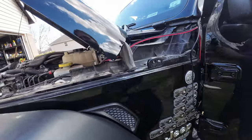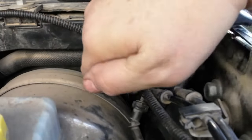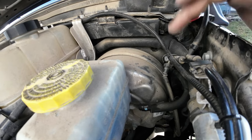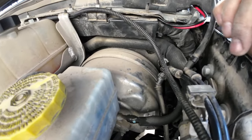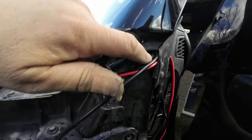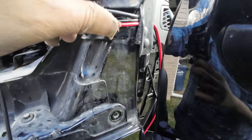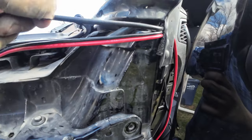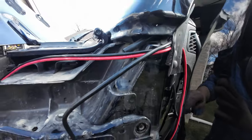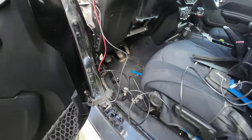On a manual, you don't have the luxury of using that little pass-through plug on the side. If you have an automatic, you use that, but if you've got a manual, that plug is blocked by your clutch pedal. My buddy Bill at Jeep Talk Show showed me this one - we just popped these two little pins free and passed it through. We got the antenna, the power line. I'll put a little more silicone on that so it doesn't leak. We literally just used a trim tool to pop these free and get all the wires ran.